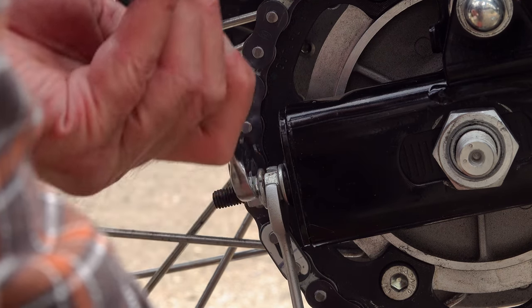So this morning, I went back, took the whole thing apart again, and tightened the axle nut up to 70 newton meters as well. Whether that's correct or not, who knows, because both Royal Enfield and Haynes are giving conflicting information on how this should be done. And if you follow the Royal Enfield manual, you don't get the job finished. It's as simple as that.